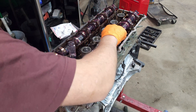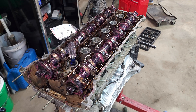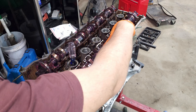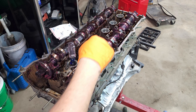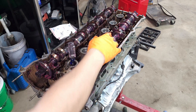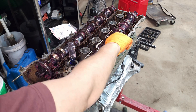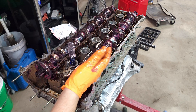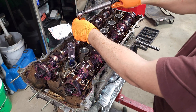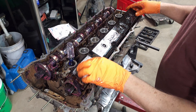Start by putting nuts on all of them that I can get on for now. We're going to tighten these down to get this cam set - I'm going to try to even out the load. Start with the middle: I'll start with 3, 5, 2, 6, then 1 and 7, and then the center one at the end. There's a final torque spec of 15 newton meters - I'll work from the inside out for that. Something about torquing bolts is very relaxing and nerve-wracking at the exact same time. Then our little cap goes over that and we are all set to continue.